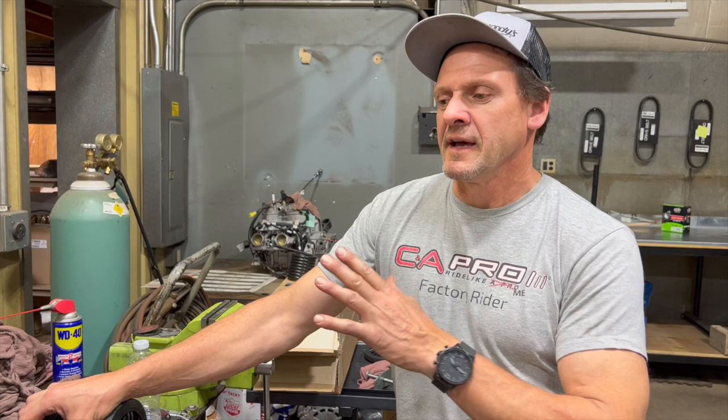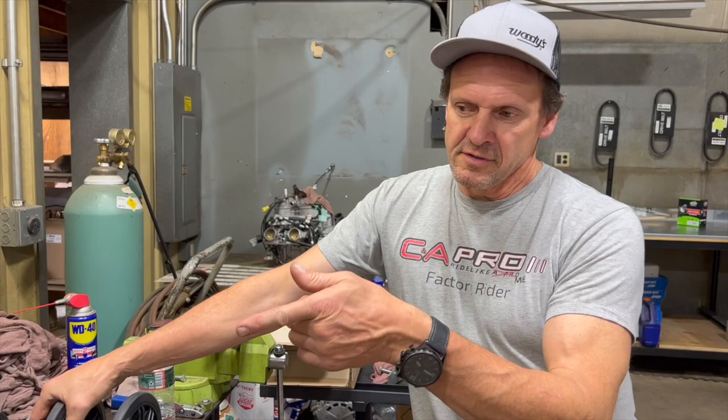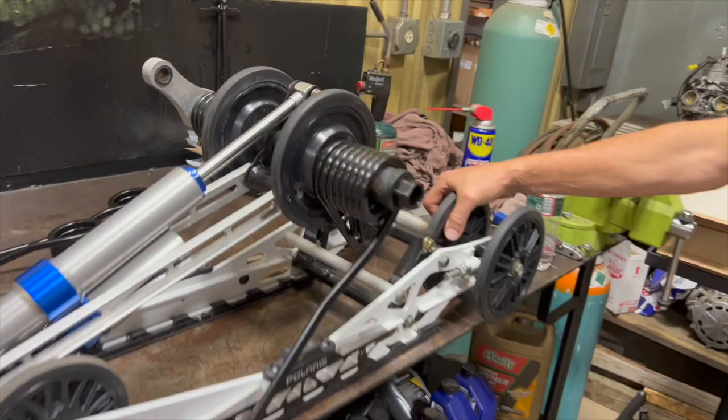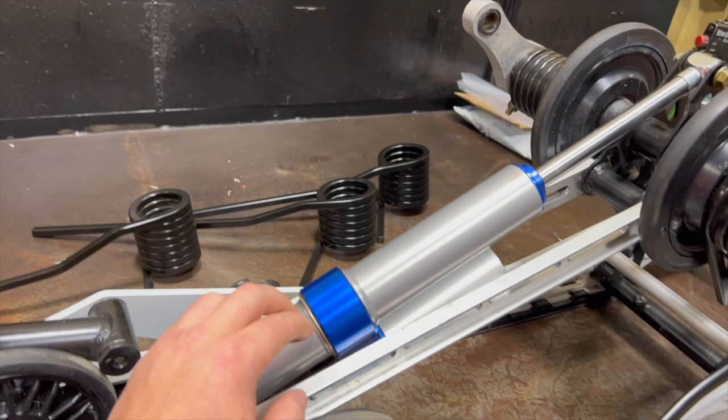If you're around 250 pounds depending on how you're riding, that's when it's like okay, we should go XHD. If it's really heavy — like 350 — we're going to the trap spring. And if it's that in-between or a two-up situation, that's where we split the hair, and you still have to deal with the rebound changes. The spring difference between the 13 pound per degree XHD and the trap spring is where we make that decision. We could sit here all day and talk about suspension, but we wanted to concentrate on spring selection.